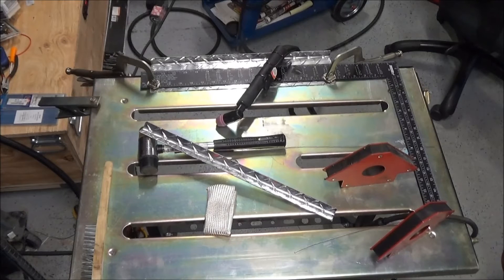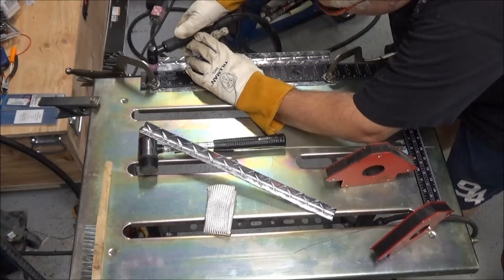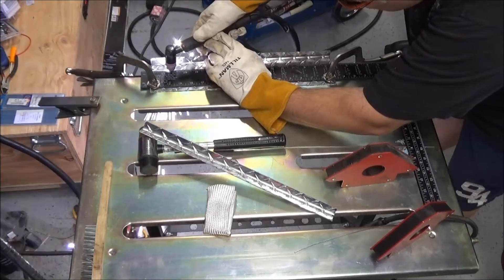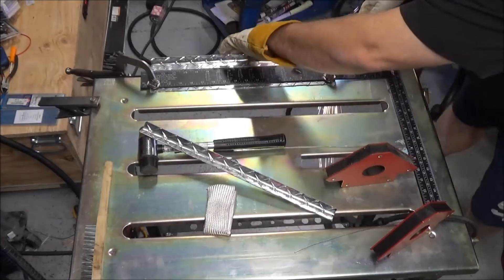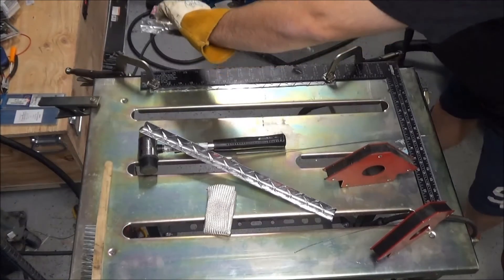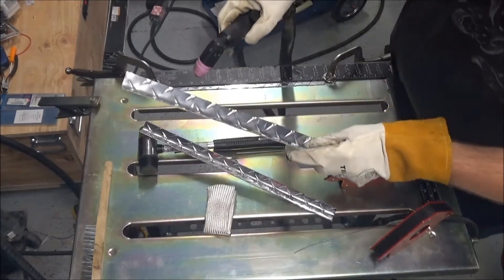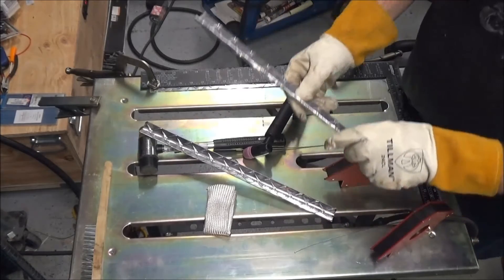Here's cutting the other side of the radiator shroud — fan shroud — L bracket out of some diamond plate aluminum. Or as the Europeans say, aluminium. This little diamond spot is a little extra aluminum so I should slow down when I hit those, but it's not going to get in a hurry.